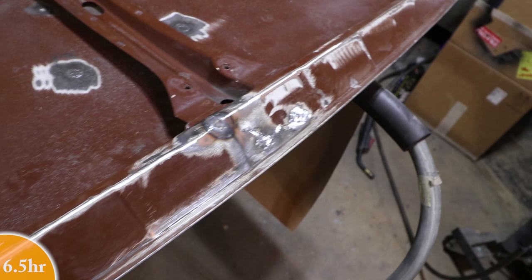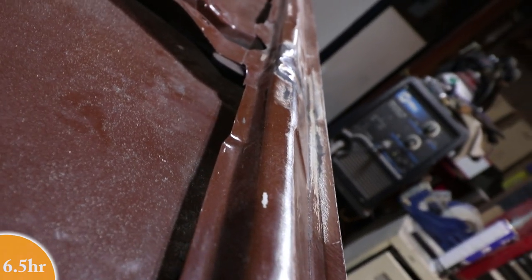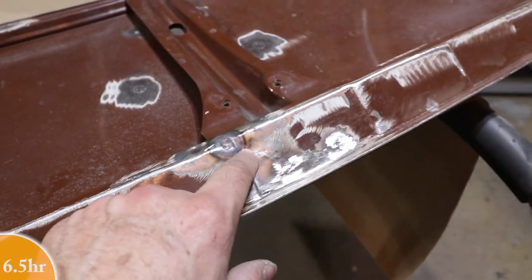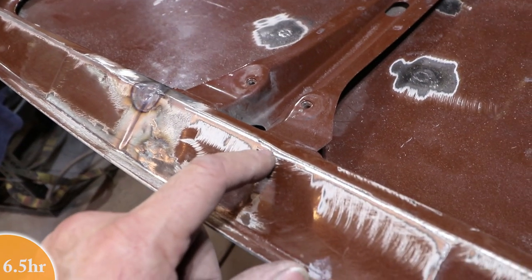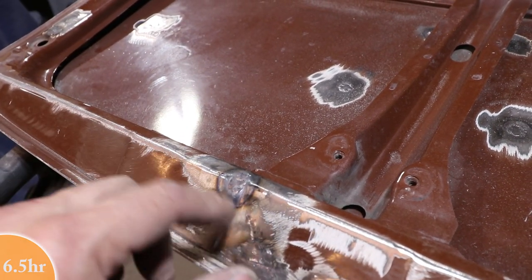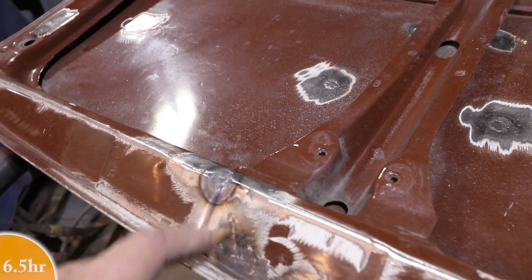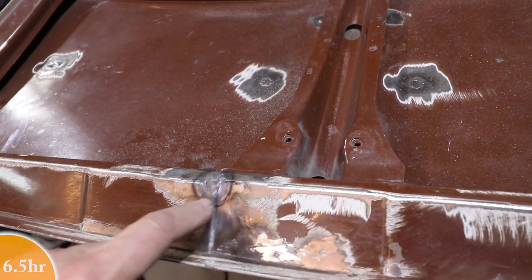I'm done metalworking on this little dent here and it came out pretty good. If you look at it from the end, that rail is pretty straight from the underside, and right here it's pretty straight too. There's a little bit of a low spot I just didn't want to chase after — it would have been hard to get in there. On the very tip of the corner I did something a little bit new for this car: I put some silicon bronze in there. Between where those washers were there were a couple of divots because I didn't grind it all down perfectly, so I just filled it up with silicon bronze. That should keep this corner as strong as possible — it's better than plastic filler here because the latch is right here and this thing is going to get slammed up and down, and I just didn't want this corner to crack in the future.